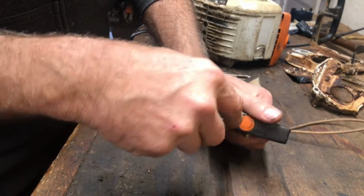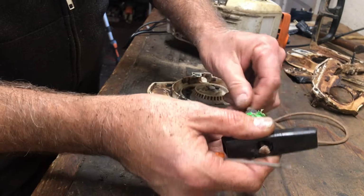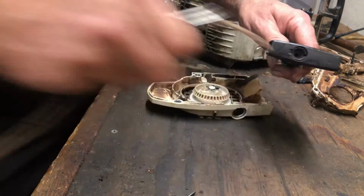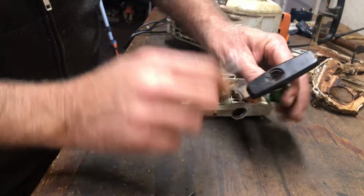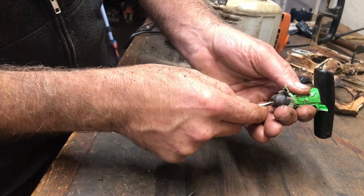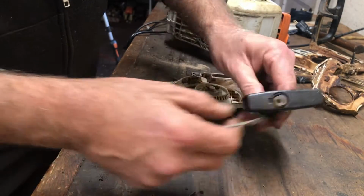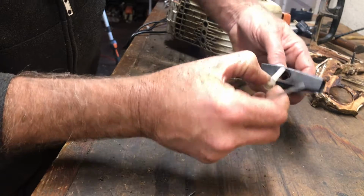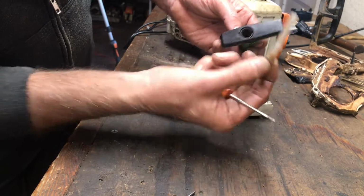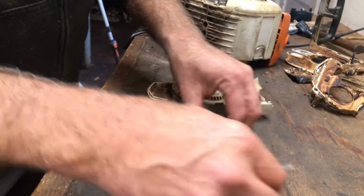Underneath here, these mini Elasto start handles have got some extra parts in here. If it comes out like that, then don't mess with it. But when you take this out, inside there's a couple of washers and a spring, and they go in sequence. Okay, spring's still in there, and there's that little washer in the end. Leave that all nice and tidy in there.